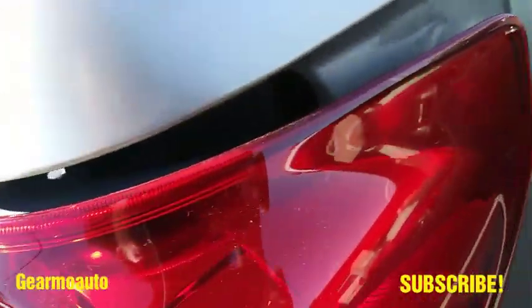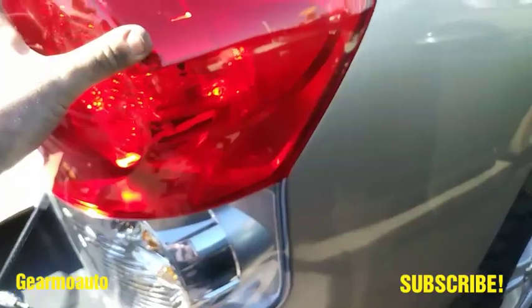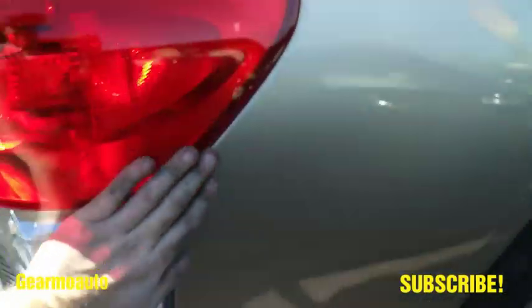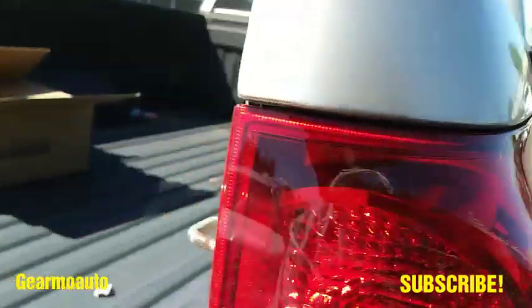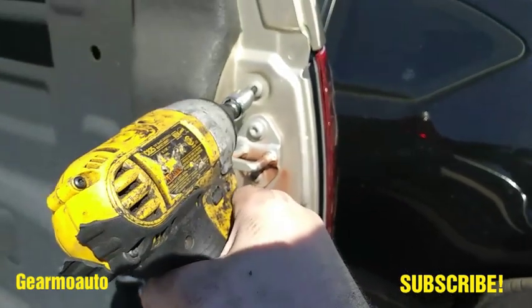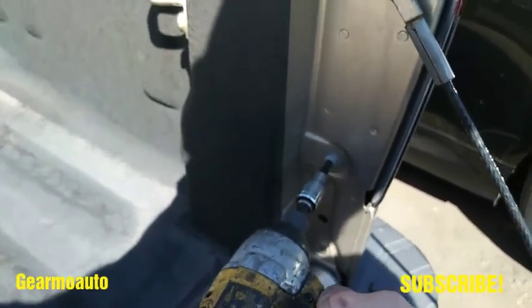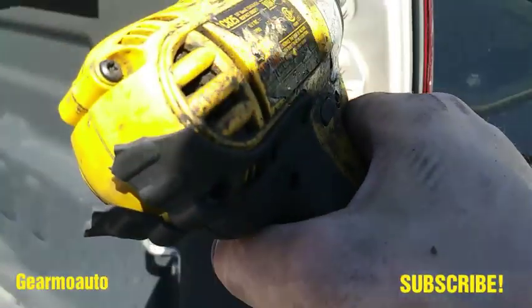There's a connector spot right here to connect the harness. Just to connect the harness, it's like a guide. And then we'll put this in. Make sure you line up these pins with the holes real good. And I'll go ahead and put these bolts in right now. Why not? Go ahead and get these bolts in. Alright, and again, this is the T30 Torx bit I'm using. I'll just get these tight. Get them tight, you know.